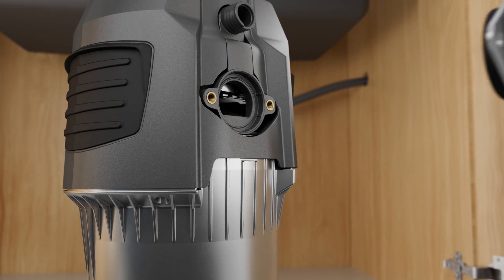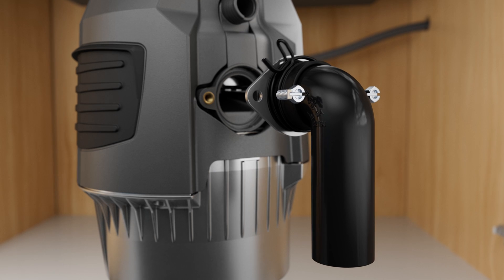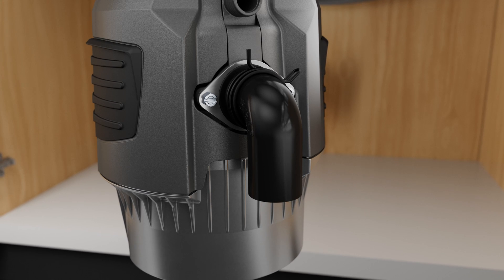Place the tube into the anti-vibration tailpipe mount. Use the provided tubes for best results. Secure with the spring load hose clamp. Note: you may need to trim the discharge tube to ensure a proper fit.